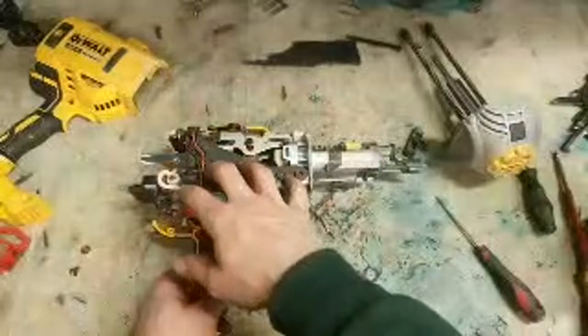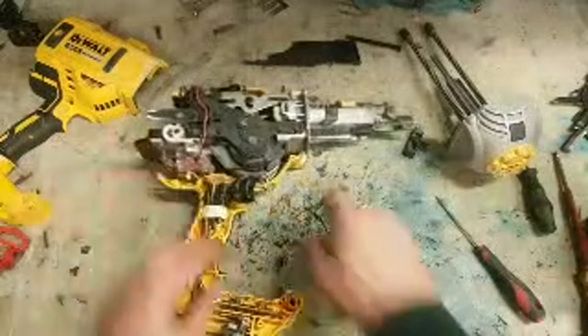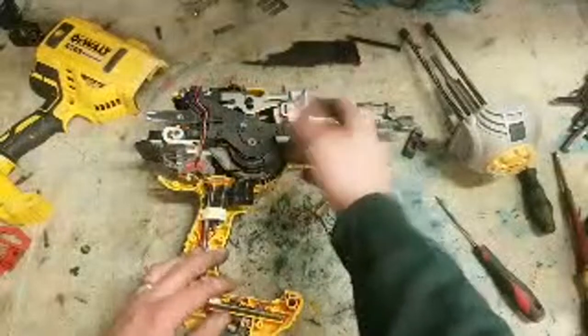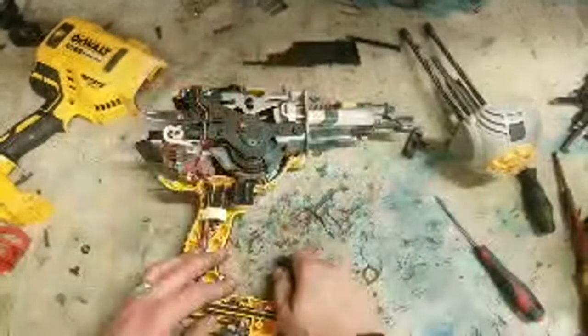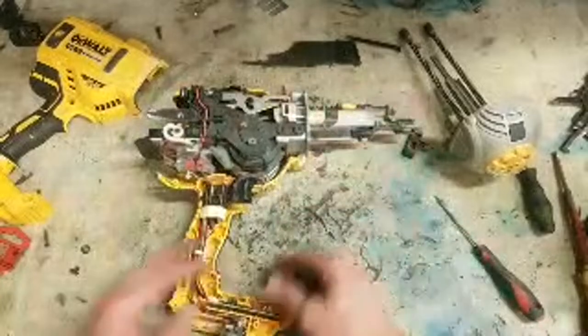That whole frame there, I know it looks very complicated, but there's not much in it. That's your controller, that just slides in. One bolt there that goes through holds it together. Either side then, this black piece is a frame. Doesn't wrap around, it's two separate pieces. Motor then bolts onto it. Axe and solenoids on top of it. Then you've got a front cone with a few other wee bits and pieces in it.